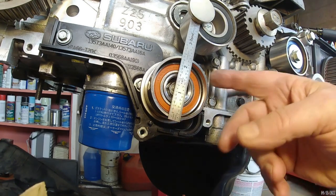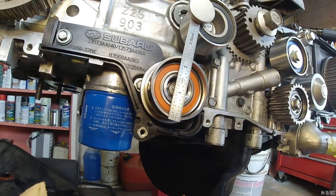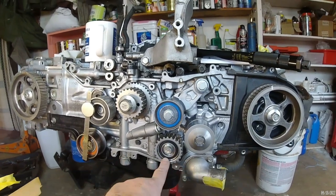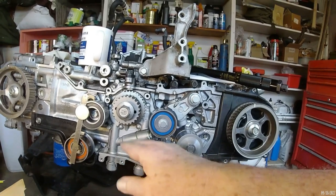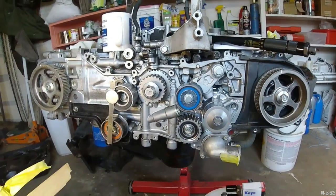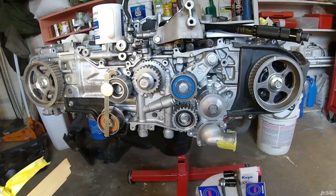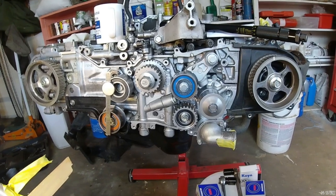Of course, when this is wobbling, that wobble is transmitted throughout the whole pulley system. It's not going to just wear out this idler. It's going to take a toll on everything downstream. Get some vibration going just because this can't hold its own. I hold this in the same category as Subaru head gaskets. Just a real poor design.